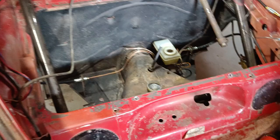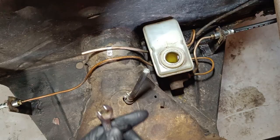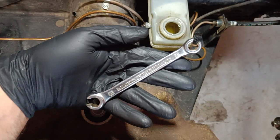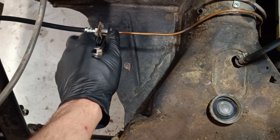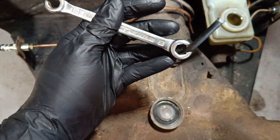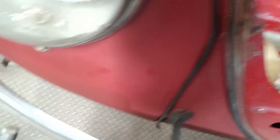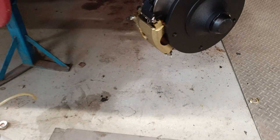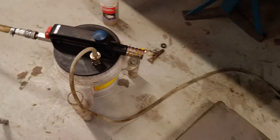Let's bleed some brakes. I filled the reservoir right to the top with DOT 4 brake fluid. I've got my special pipe spanner — one of the best things I ever bought — it has the 11mm fitting for the brake line connectors. It's a pipe spanner so it fits over there nicely. So many times if you use an open-ended spanner on these brass fittings they round off, but with this it works so much better. And on the caliper the bleed screw is a 10mm — that's why it's a 10 and 11 combo.